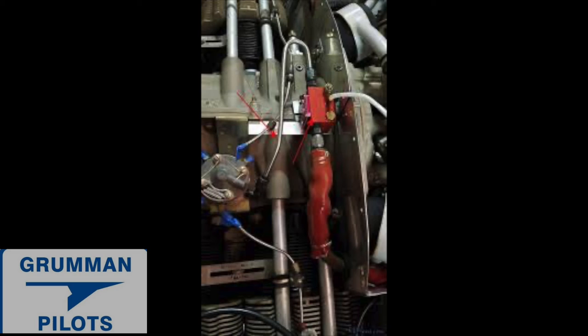They broke three rules, and I'm not really worried about the steel fittings specifically, but when you get it all done right you'll get a much nicer fuel flow reading and you won't be violating any rules of the installation manual. Violating those rules voids your STC, which means your airplane is not airworthy. So make sure you do it all right — don't be an idiot, follow the instructions and do what they say. Thanks for watching, and have a great day flying your Grumman.